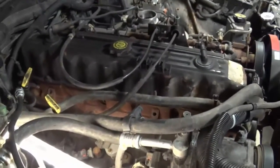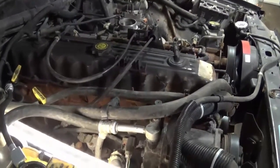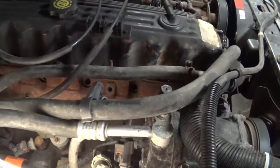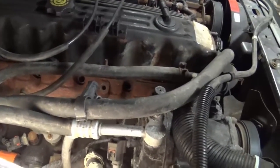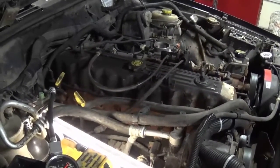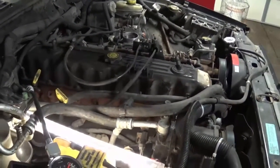This motor does have a knock, and the knock I believe is piston slap due to this being an '01 4-liter. The full diagnosis of the knocking will be in another video. For the purpose of this one it's simple: removal and replacement of the spark plugs and coil pack — I'll have to fix that one broken clip. Putting it back together is the same as taking it apart. So there's checking the compression of this 4-liter. I won't know the full picture until I get inside this motor and see the condition of cylinders three and five, which will be another video. See you next time.